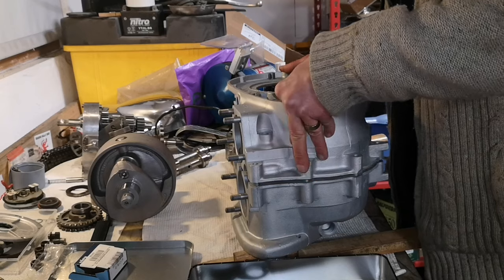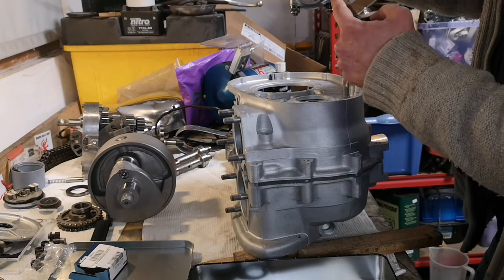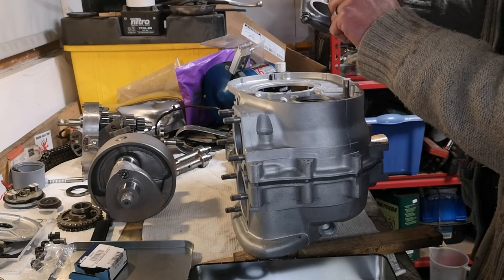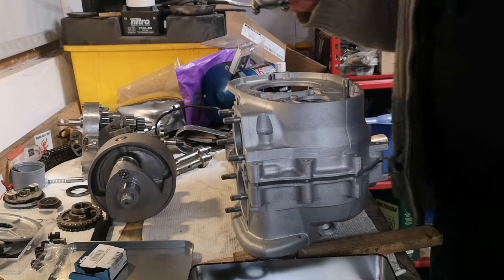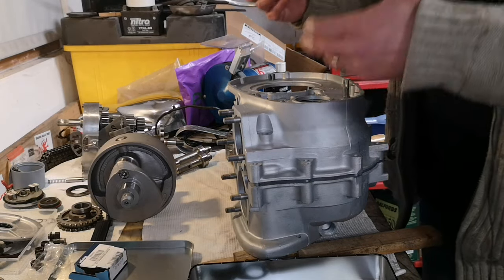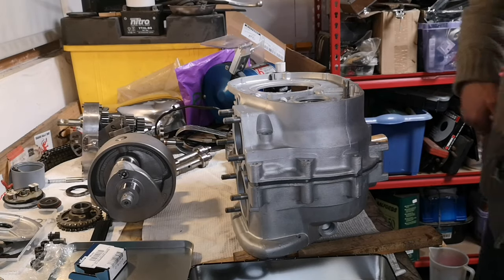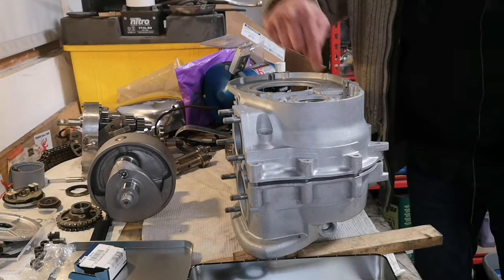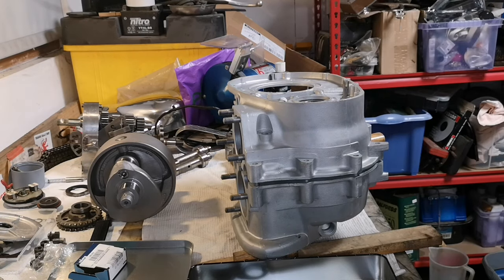I might just drop it on now because it just looks so good. Yeah, that'll go on there and it'd be brilliant. I'm waiting for my big end bolts - they'll be here extremely soon. I've got a couple of bits to send back to Pat which are wrong, just in the wrong bag. So yeah, these rods will be able to go back in, which will be lovely. I've got to bolt the rods to the crank, put the crank in the engine, lock the two sides together, and from then I could put the pistons on, barrels on - we're cooking on gas then, we're really getting there. Very exciting. Next video I reckon we'll have a crank in the crankcase and the bottom of the engine will be together. Thanks for watching, see you again soon.